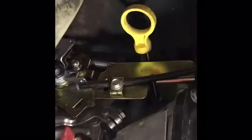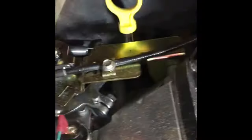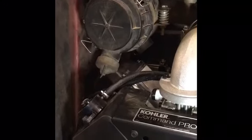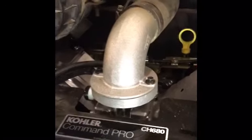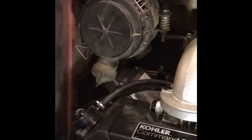Hook up your throttle, choke, and throttle cable. Lock them down, but don't lock them so hard that the cable won't go in and out — you want to secure it enough that the cable doesn't move back and forth. Hook up your air filter system with the bracket and air filter housing back to your engine with the clamp. I put two new air filters in because it's a new engine — no need to run dirty air filters. Make sure the cap is pointed down so rain doesn't get into your engine.